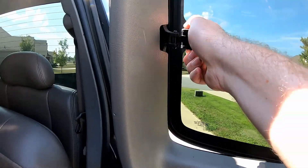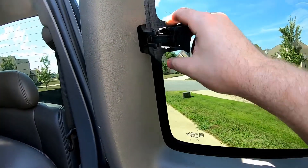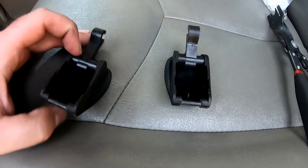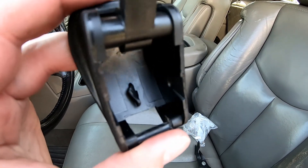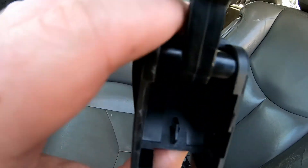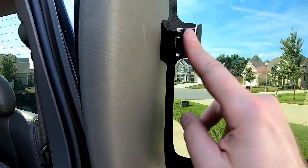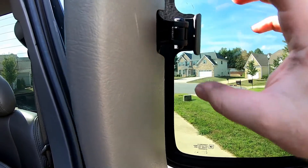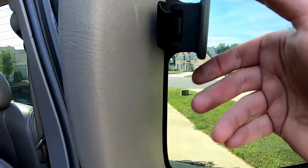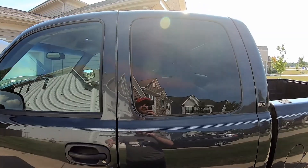Here is the factory worn-out hatch — it stays in place but when you try to clip it, it doesn't lock at all. It's just worn out. I want to show you the two pieces side by side: here's the new one and here's the old one. You can see that plastic tab inside the clip is actually deformed — it looks like it has melted or snapped, or a combination of both. The new one is just a straight piece and it's fine. After installing the new latch — you twist to pop it off, then twist right to find the slot and pop it out — and now when we close it, it actually latches. That door is closed and it's not popping out.